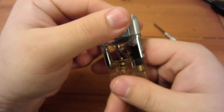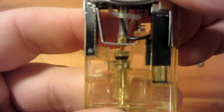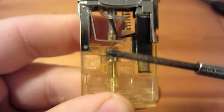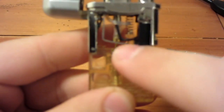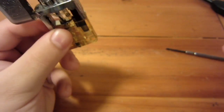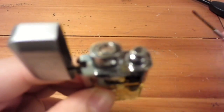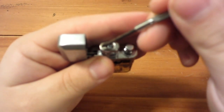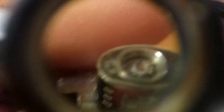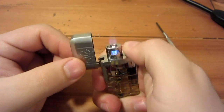What I realized after looking at this closely is that when you first open the top, it actually lifts this bar up. As you open the lid, see how that lifts — and by lifting up it's actually releasing fuel through this tiny little clear hose, which in turn slowly leaks out of that little hole to the left. So right now with the lid open, it's leaking fuel.